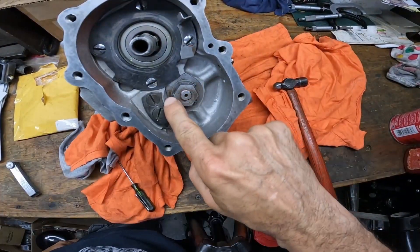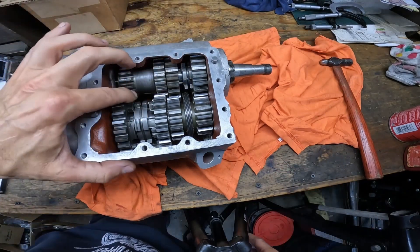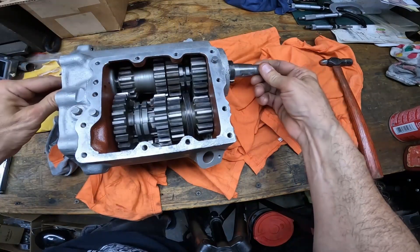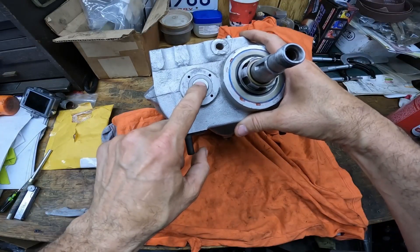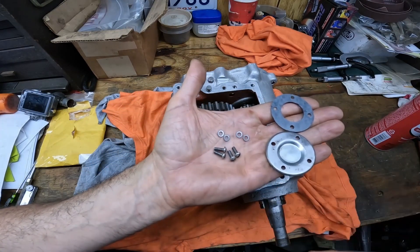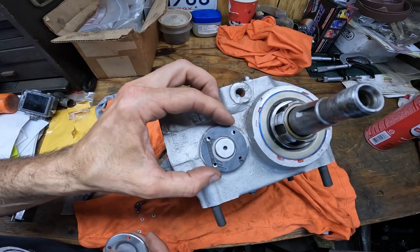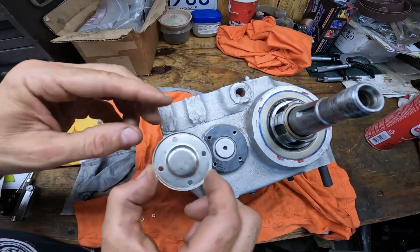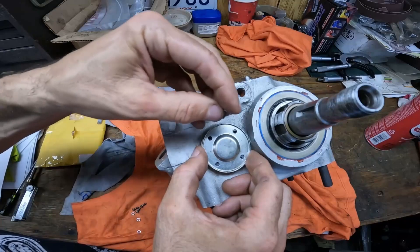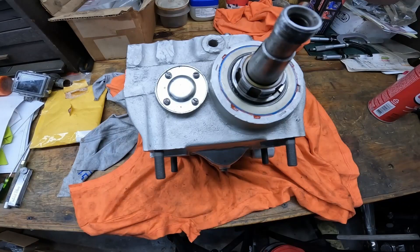It's nice and tight. You can see: here it's in main drive gear or fourth, here it's in third, here it's in first, and here it's in second. The gear case is assembled. Next I put the gasket and cover on the counter shaft. The parts are the cover, the gasket, four screws, and four lock washers. Put the James gasket on, then the cover, lock washers on the screws, and run the four of them in.